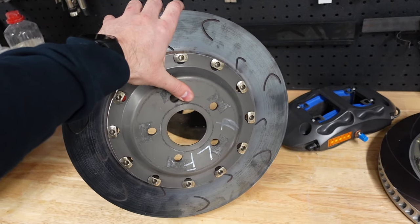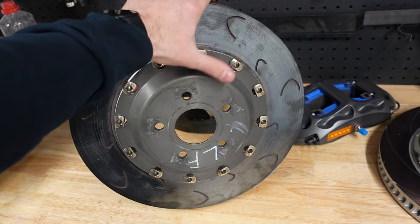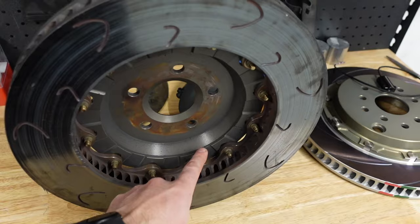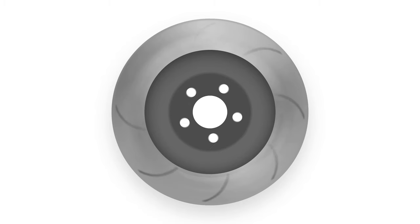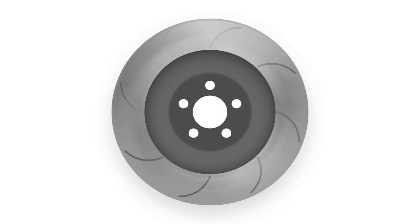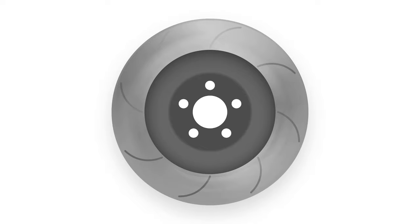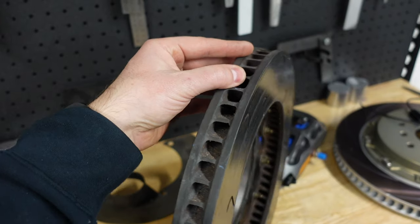Here we've got a well used motorsport disc. This is the front face and this is the area where the wheel would attach to the car. The shape of this disc means that the air actively wants to travel through the inside of the disc, which is what gives us our cooling. Once the air has passed through the disc, it exits out through here and finds its way out through the wheel and into the outer airstream. The style of these vanes and how open the wheel is can have quite a big impact on how well the brakes are cooled.